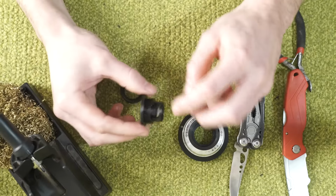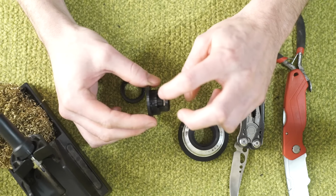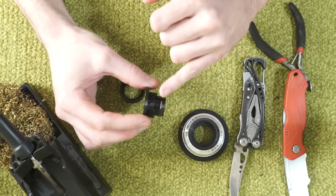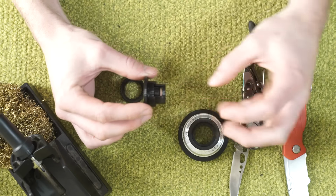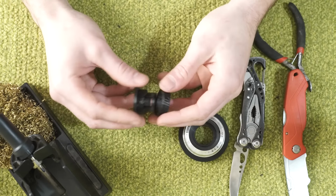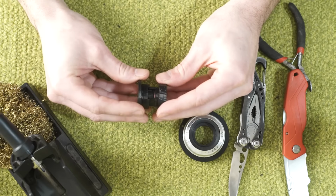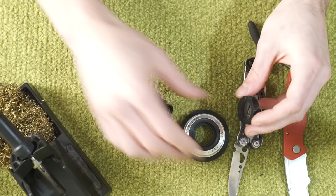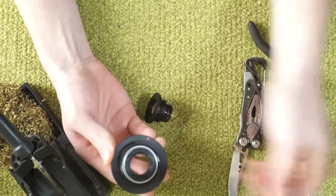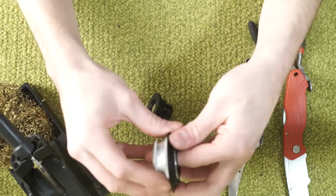There's a section over here where this pie cutout fits these little messed up pieces inside this lens. You would have a light leak out this side, except for the fact that the way this fits together, it will block it with this next piece. All right, so this piece sleeves over this section here. As you can see, it doesn't fit quite right. This will be the backstop on this section of the lens that fits in nice and tight right there. And the rest of the lens will shove right through there.